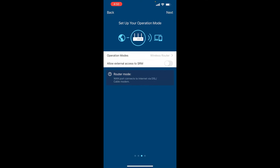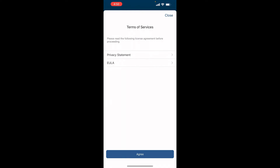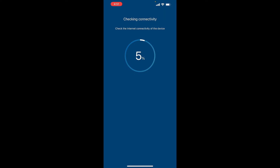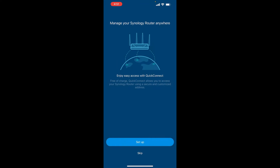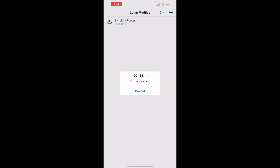Next, we're going to set up our first Wi-Fi network — you can choose the name and a password, and that will be the network broadcasting from your router. We're going to choose router mode and check allow external access. We'll leave this to automatic, choose Agree, and it will apply the settings to our router. It's asking if we want to join the new Wi-Fi network we created — we say yes. It will verify connectivity and may apply updates during this process.